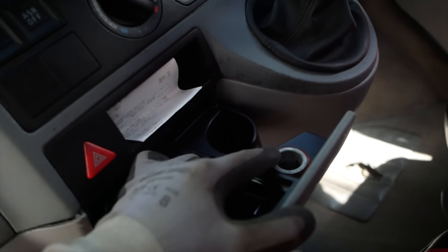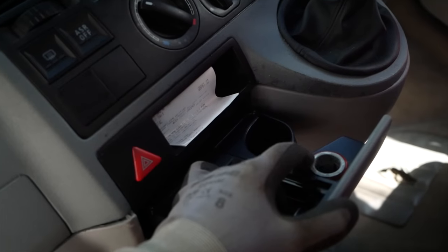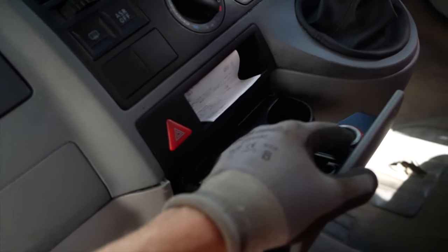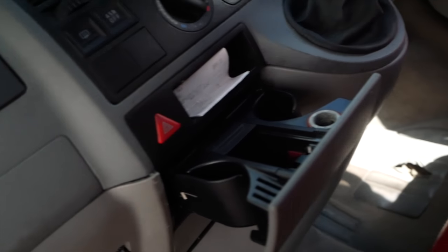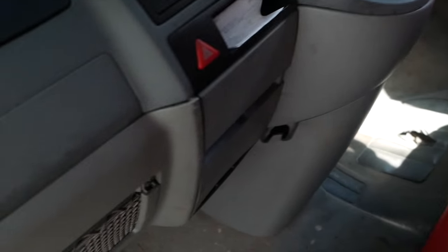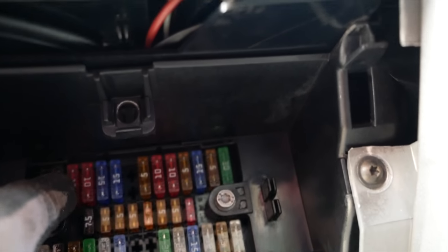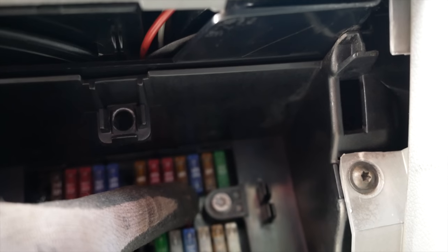I'm pretty sure that when I picked it up, this outside ring was working. But with messing with the electrics and stuff that's been done, it's now fused out. You'd think it should just be a simple case of pull the fuse from underneath and swap it out. I've looked on the T4 forum and Brickyard — it says pull out the fuse cover and it should just be position 12. Third from the end — let's try pulling that one. There it is, a 15 amp fuse, as you'd expect.